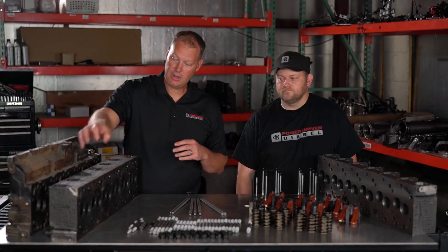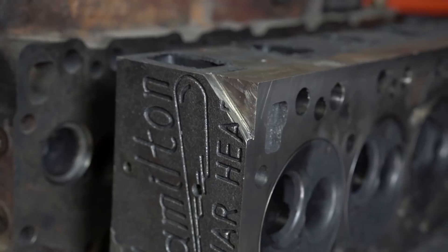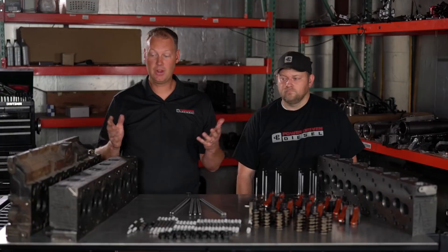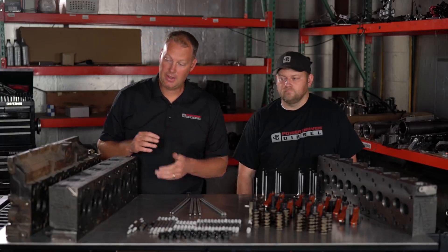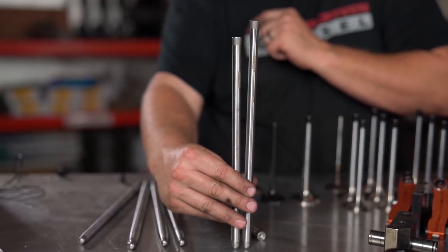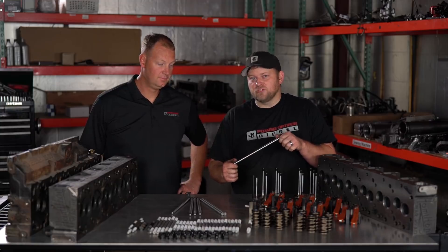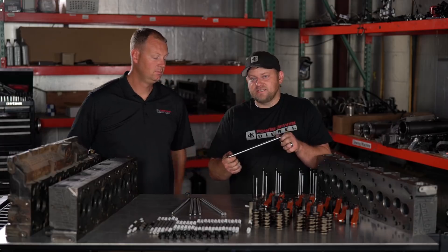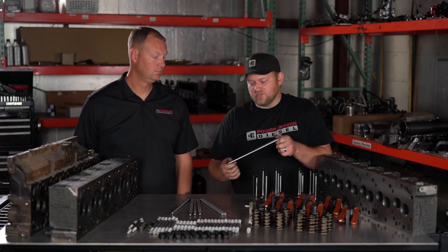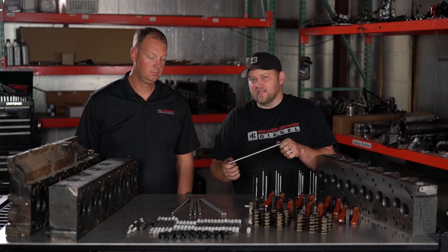Another quick thing you'll notice is we had to cut a notch out here. This head is a little bit longer than the standard one as well, and it interferes with the gear cover itself — just a little notch we had to cut out. I've had to do that on every motor I've done so far. Because the head is about a half inch taller than a factory head, the factory pushrods are too short. We had to get some custom length pushrods made. Most guys running a Warhead are at that extreme performance level, so we start with a 7/16ths pushrod — not a 3/8ths like factory — then generally go with our Stage 2 heat-treated version. On competition engines we'll go all the way up to a 9/16ths pushrod.